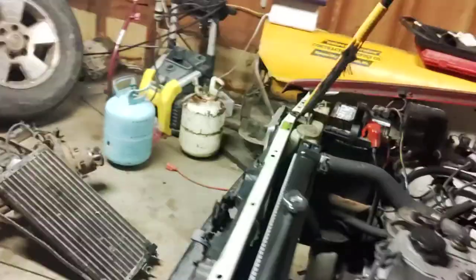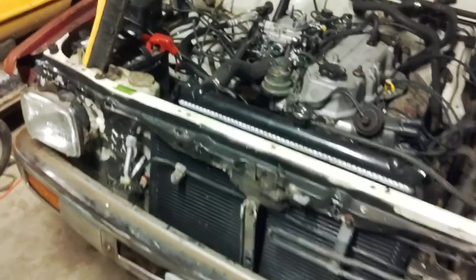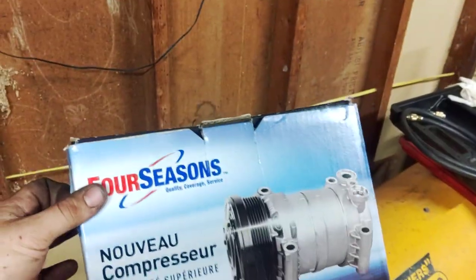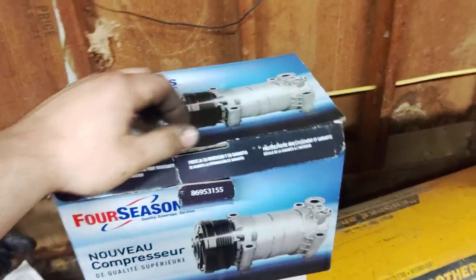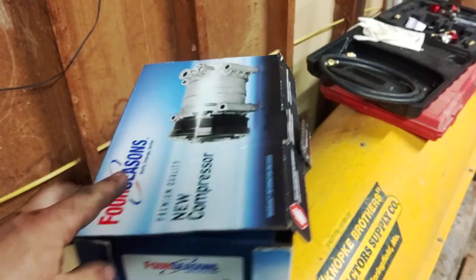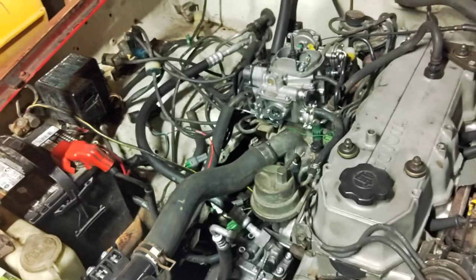That's air conditioning. I highly recommend putting one of these connectors in — I bought this one through CarID, because right now they seem to be the most reliable source for these upgrade connectors. For the compressor, I highly recommend a newer remanufactured one — Denso is probably preferred. I had this Four Seasons one — it was $350 out the door in stock at AutoZone. This particular part number on the Advanced Auto website said when it's out of stock to replace it with something else, so it ended up being a new compressor instead of a reman, which is super nice. $350 for a brand new one is a pretty good deal.